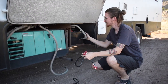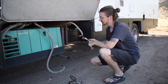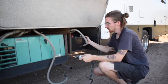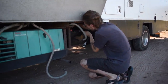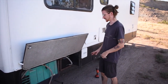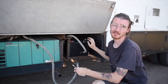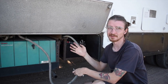I'm going to wire these two batteries in parallel. To do that, I'll take a jumper and connect both the positives, then connect the negative. Now that the batteries are connected, I'll connect to the RV — I want to put the positive on the back battery and the negative ground on the front battery, so they both act as one battery and one doesn't drain at a different rate than the other.